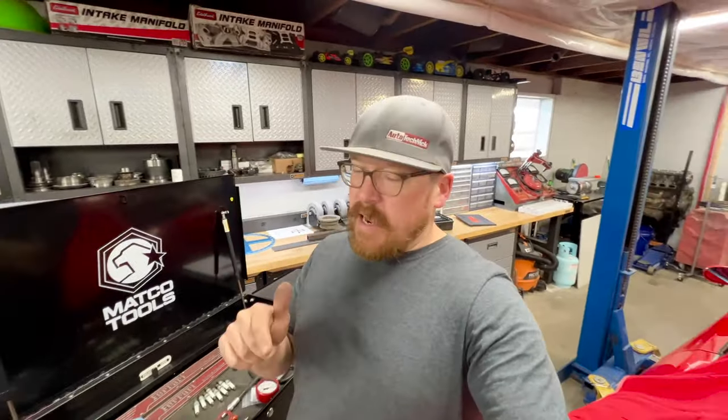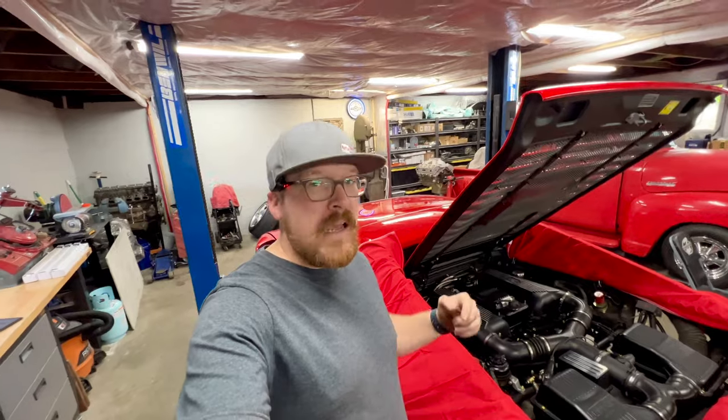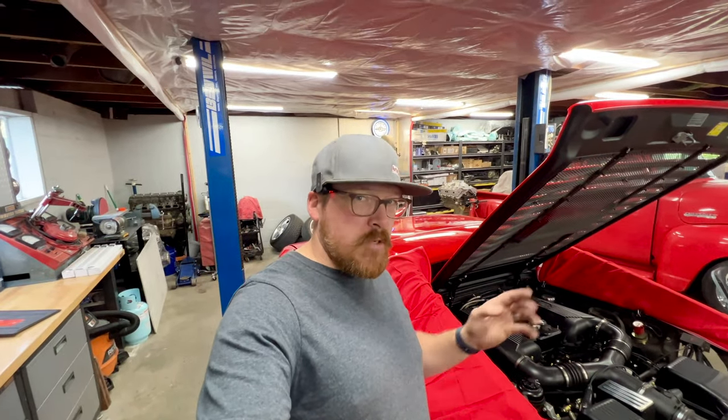So it doesn't drive any alarm for right now, and it kind of drives the point of the importance of why we're checking this, and also the importance of why we're going to check the cam timing before we pull the belts apart. Yep, it takes a little bit extra time, but it informs us on the condition of the car when we got it. And again, it just gives us a little bit more knowledge and information so that way we can be sure that this car is sorted and ready for the customer.